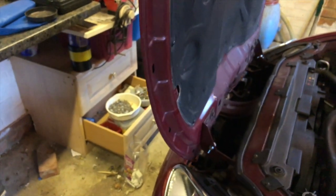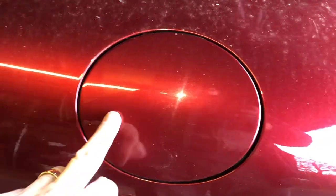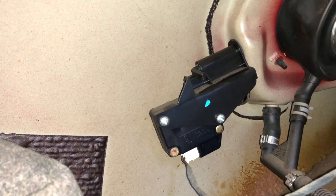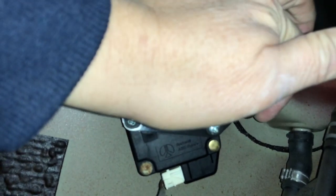The second secret for this episode is around the fuel filler flap. We've covered how you can open the boot if you have an electronics failure or flat battery, but the fuel filler is electrically operated — so how do you release that? You can't press it like you do with a lot of fuel flaps on cars. But if you pull down the trim just inside the boot near to the fuel filler flap, you'll see the servo, and below it — where I'm pressing — is a little button. You operate this and it manually releases the flap.